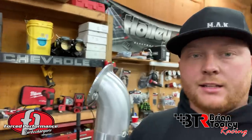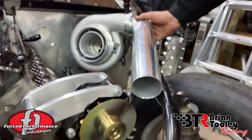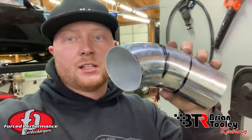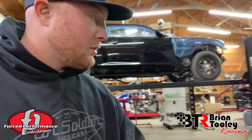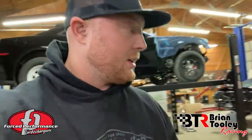I found a tight radius 90 that I had, cut it at a 60, and it literally puts that tube exactly where I want it. I'm going to clamp this on there - I think this is a 30 and it's almost a 90 degree angle, so that's a 30 here, which means I only need a 60 left. I'll fit a little piece in between there and this cold side is basically already done. I just cut the 60 but it's just a little too much, so I'm going to take a little bit off with my hefty homemade bandsaw. Me and Moon designed this table - Moon cut it and made it all - turning this awesome horizontal saw into a big vertical bandsaw, saves $3,500 instead of buying another one.